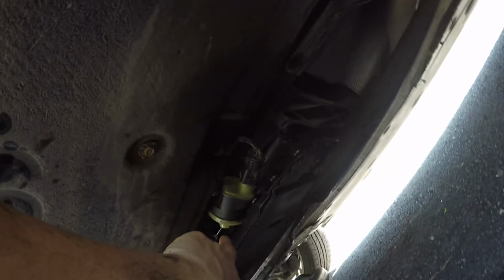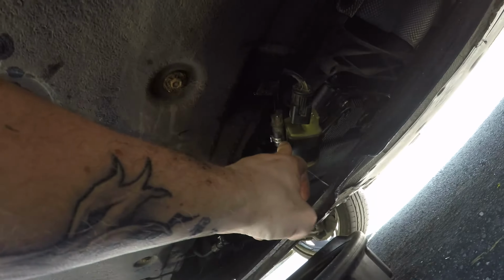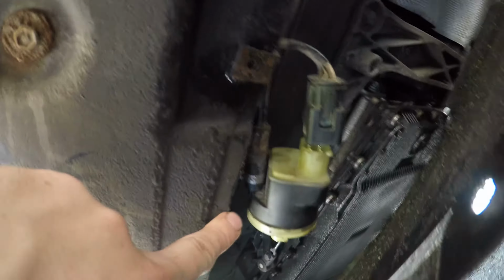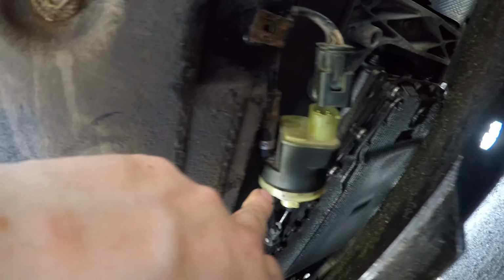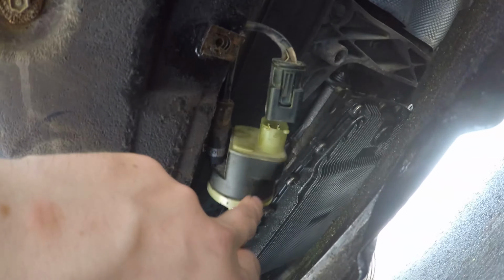And basically the diesel heater has a fuel line into it, as you can see here, and that's got one of those weird one-time clips. I wouldn't recommend removing that if you can avoid it. So yeah, you can just pull it off. What I found the easiest was, there's a bracket which I'll show you in a second, and that just has a 13mm hex head on it. Take that off and it drops the fuel filter down so you can just manoeuvre it about a bit.